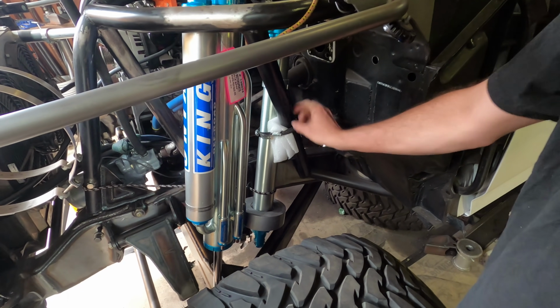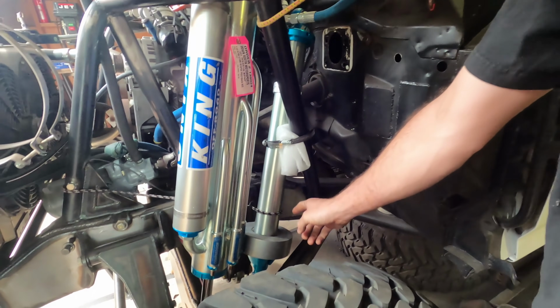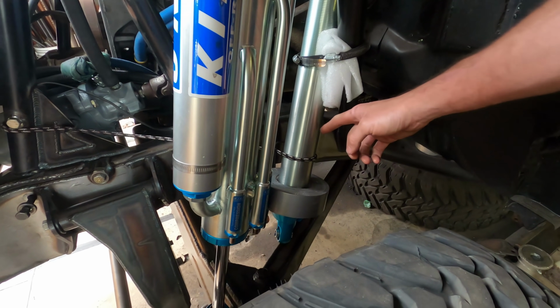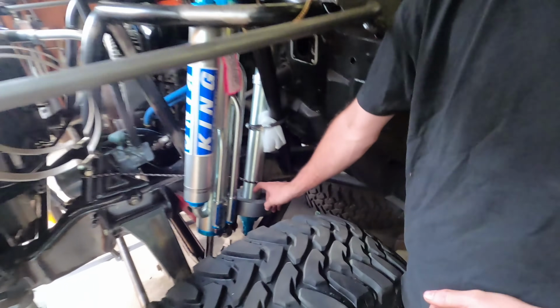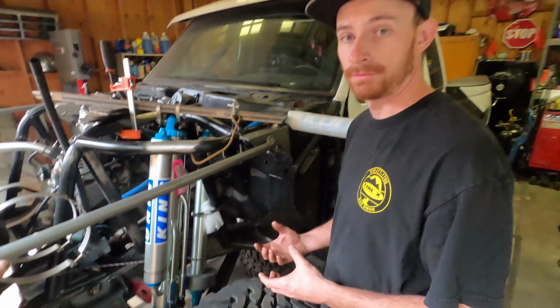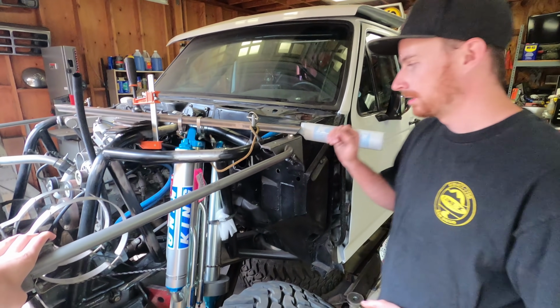So you can see there's a hose clamp here around this engine cage tube just to hold this coilover in place. And then because we're going to be running a 375 diameter lower spring on this coilover, which is meant for a 3.0 diameter shock... Yeah, it's a big one. We're just using a roll of duct tape, which is really close to the outside diameter of what a 375 spring actually is, just so we can make sure all the clearances and everything are good.